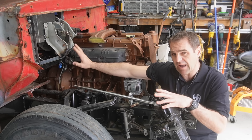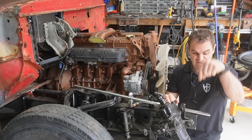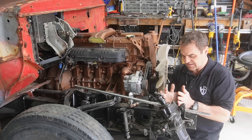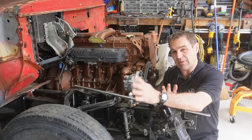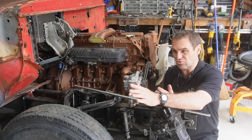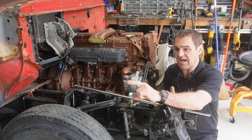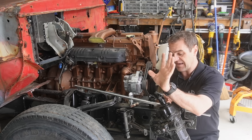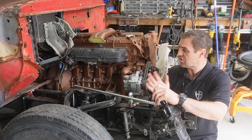Let's take you in and show you what I'm currently dealing with. Last week I put my steering column in, and this is where my steering shaft comes out. It's a two-piece steering shaft from the Toyota Coaster that used to go basically straight down to the steering box, which I've relocated slightly further backwards on the chassis. Now I need to get this to join to this over here. The tricky part about playing with steering is it's not legal to just cut and weld steering components in Australia - well, technically it is legal, but you then have to send it away, get it X-rayed and certified that it's strong enough, which is a big headache.